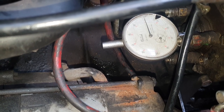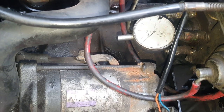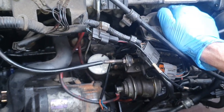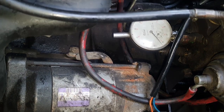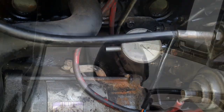There we are — we're at zero. I'll get under the van and reset it to 10 degrees. So, we can see we're currently on between 60 and 70. I'm just going to rotate my pump like this — like an old distributor — until that gets to 40. There we are. That should be how the timing is set. A lot more fiddling than I was hoping for, so I'm going to get this buttoned back up and we'll take it for a spin.